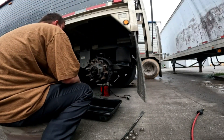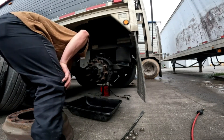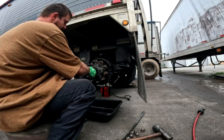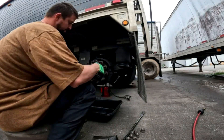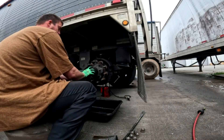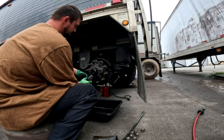It is quite amazing that this wheel seal did not ruin these brakes. Now with this style of lock, you can see it's a six-point style. It's pretty much as loose as it is — you can see it's turning by hand. All you really do is take your hammer and bump it up on there to unlock the locks. Usually taking them off you can just do it by hand, unless it's got the double lock style.